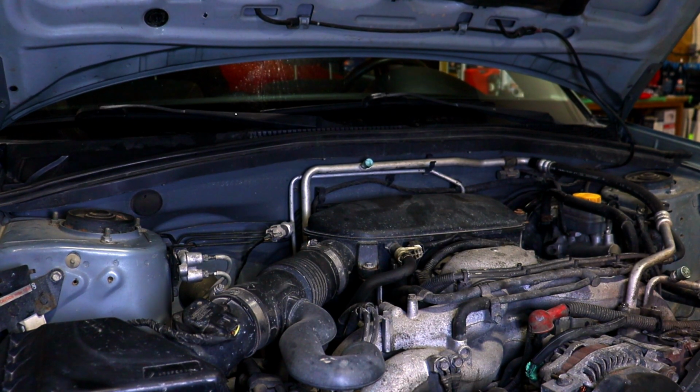So we did have to drain about 500 milliliters, so half of the jug that we put in extra that we had to take out. After the vehicle got a little bit warmer and we checked the fluid level, it's right on, actually right below the full level, so we should be pretty good now. We were able to take out about 500 milliliters by playing with the drain plug a little bit to drain slowly. Now I just checked the dipstick and it looks like we are at the right fluid level. So that part is done.